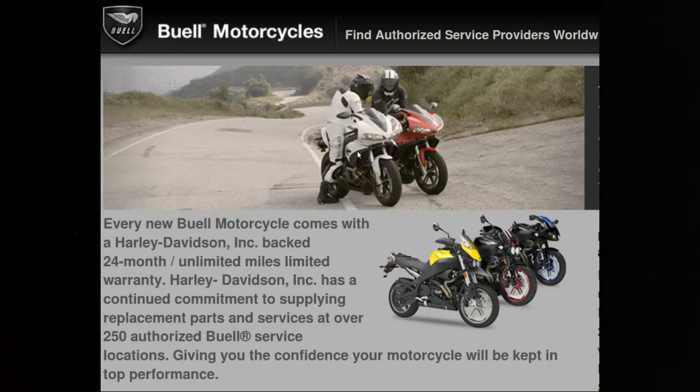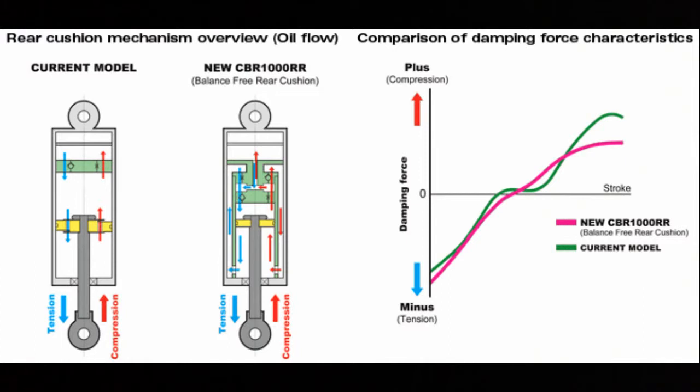The Japanese, and Honda certainly, make a good solid bike across their line. So they've come up with their new Showa rear shock, which addresses another issue that for a long time confused me, or at least I haven't understood exactly what was going on with it, which is shock hysteresis. They have a diagram on the page, right under the Unit Pro Link, which explains the hysteresis effects and how their new shock addresses hysteresis and also allows them to fine-tune the shock performance better. It's a very good explanation, and you can see clearly the hysteresis that results from traditional shocks.